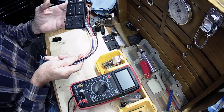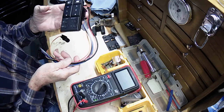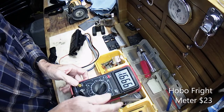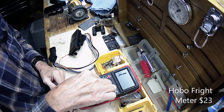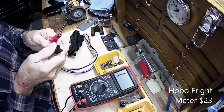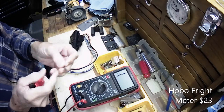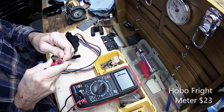So if your windows aren't working, just take the switch out — this is the easiest way to test it. I've got my meter here. I'm going to turn it on. We've got it set for ohms, and I've got it on the beep section so I can hear it beep when I get a direct short. I take one connector and I've got a hardware store spiral pin that'll fit over the pin in the connector, and I clip that on there.